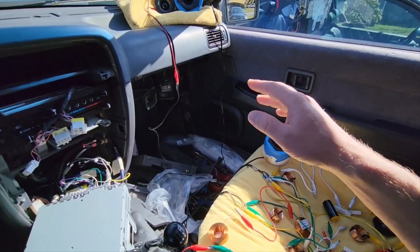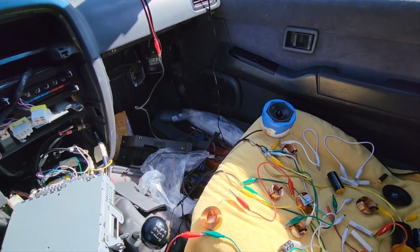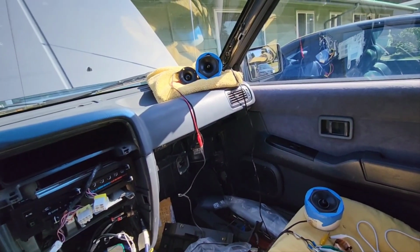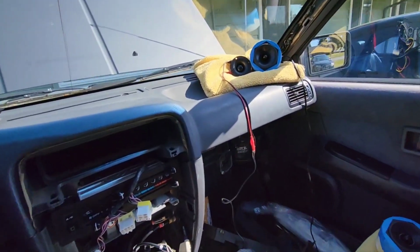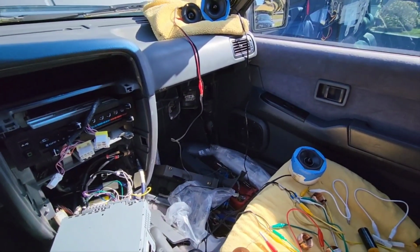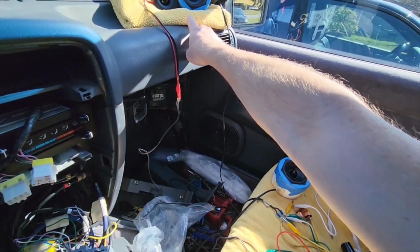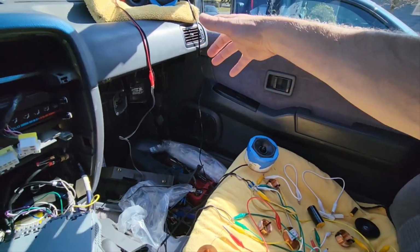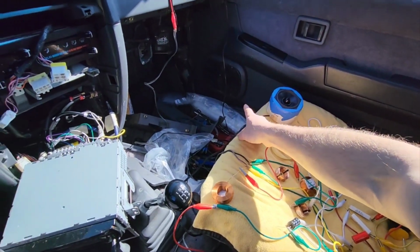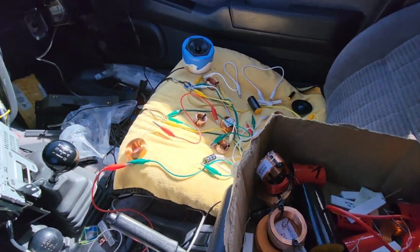It sounds really good. I'll probably do a demo after I get all the speakers in and get all buttoned up. But the final selection I did, and all these speakers were highly rated for car audio, so I went through a lot of testing. This might be helpful. I went for the Peerless Textile Dome Tweeter, it's the BC25SC06-04. I went for the Dayton Reference RS100-4, 4 ohm, 4-inch aluminum, and it has a standard ferrite magnet. And for these guys, it is the Dayton aluminum neodymium ND140, 4 ohm, and it's 5 1/4. And I made the template out there.